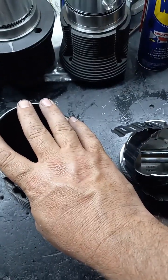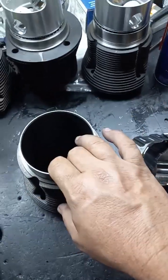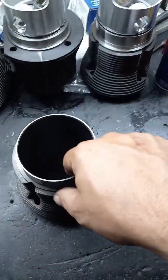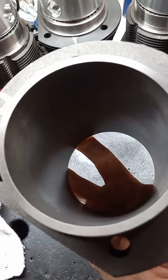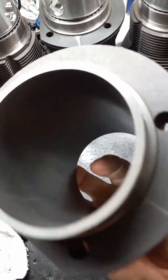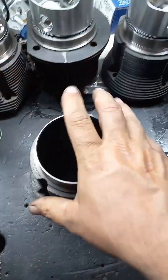For the customer, it's not a bad idea to either pull the piston out, or when you go to install it, oil the crap out of it. Pull the piston up until it's all the way back, flip it over, drench it with oil there, and slide the piston back up. It's a good idea.